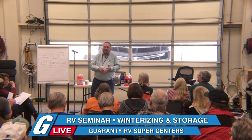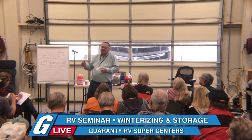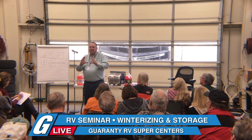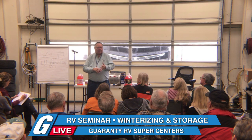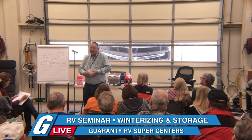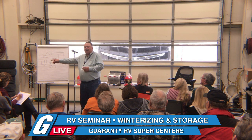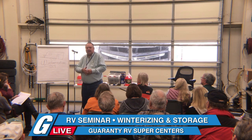Two things are going to happen. Number one, the electrical system is going to overheat because it's not designed for such a heavy constant current. One little cube here takes 15 amps. If you have a trailer with a 30 amp service and you're trying to charge the batteries and you run two heaters, you have exceeded the 30 amp rating of that trailer, and you have your little 100 foot vacuum cleaner cord plugged in, and that thing's going to get so hot from resistance it's going to melt.